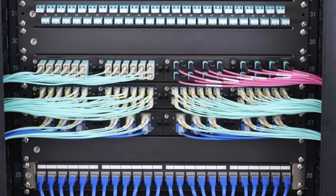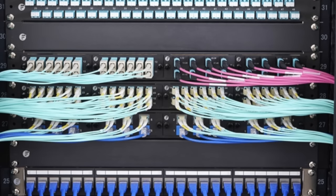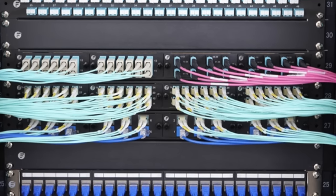In terms of interconnect, I did all of the 25 gigabit cabling as fiber. If you don't have native RJ45 ports, or if you're near or beyond the 100 meter mark, or if you need to run new cable anyway, it's likely a good time to start looking at fiber optic. If you're anything like me, fiber optics seem somehow fascinating, even exotic — you may have a rough idea how it works, but not the slightest idea of what you'd actually have to purchase to make it all work together. It's time to relax, because I've already researched it for you.